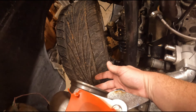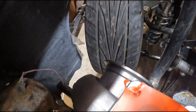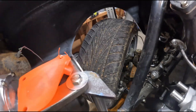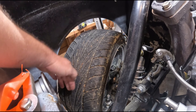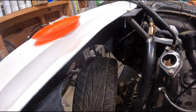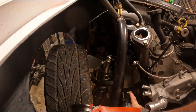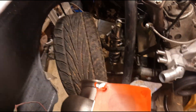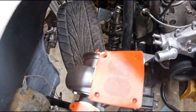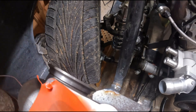After thinking about the exhaust, I was kind of worried about my tire hitting it. We're just going to be close. I really can't tell right now — this is the front suspension fully extended. It's going to come up some more, but I think as long as I come up with a 45 right from the get-go, I should be all right. If not, we can always come this way. I know that's pretty tight right there, and this part stinks because I'm fixing to do a whole lot of work on the hot side and then be worried about this — but I think there's enough room.